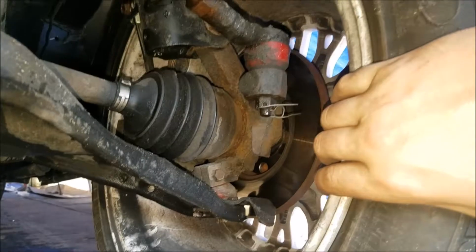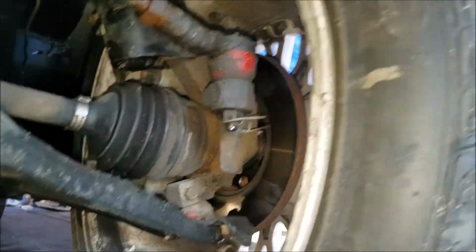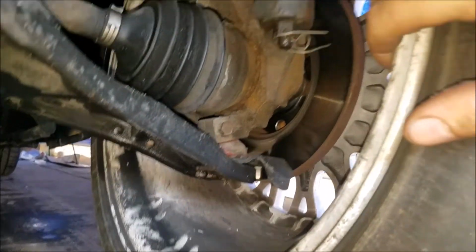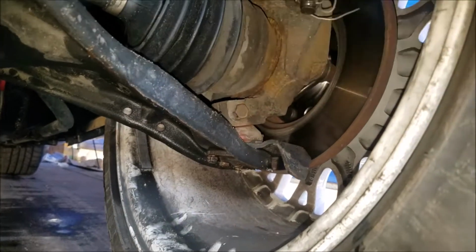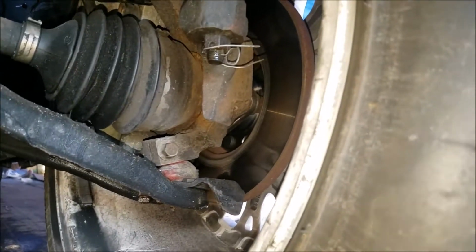Alright, so today I did a little bit of tuning with Ben, and now we've come to a stop because it's getting a little sketchy. It's hearing thudding. And I'm pretty sure my rear lower ball joint is messed up. Let's see, we'll come down here. If I move it side to side, now this is going to be impossible. But yeah, I'm seeing it. It's moving. That I don't think should be moving.